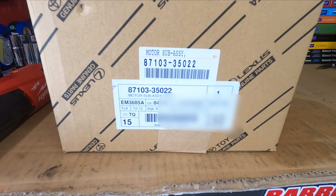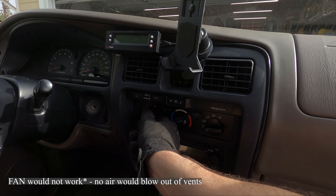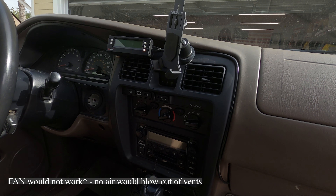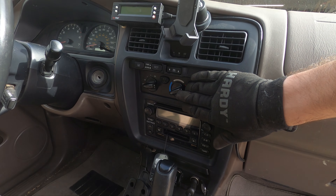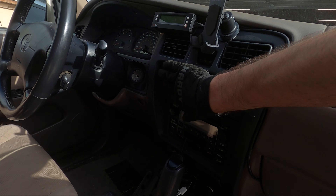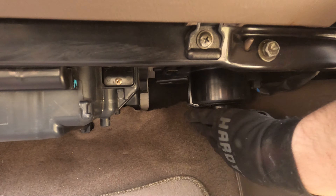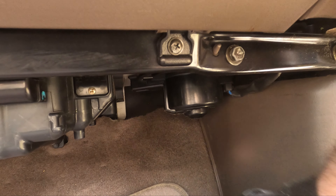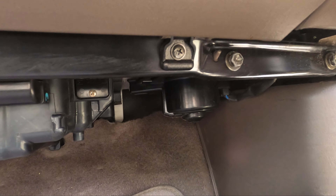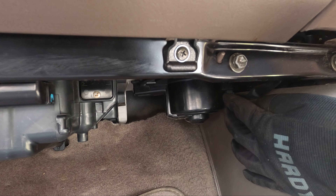Here's the newest part number so far from Toyota, filmed in April of 2020. Here on this customer car, the air conditioning would intermittently not work on all positions, all settings. So obviously with something like that, we're not worried about a resistor. We're looking at maybe the panel of the unit, if it's got power and ground. So I always do a tap test first on stuff like this. I'll do a light tap up here, light tap around the panels down below. And if I can access the motor, which I can here, I'll do a quick tap test. When I did that, the motor would respond and turn on. Or if I went over speed bumps, if it wasn't working, it would turn on. So I knew the motor here was kind of glitching. I pushed on the connector to make sure the connector was seated and I did have good power and ground. So we know the unit's bad.